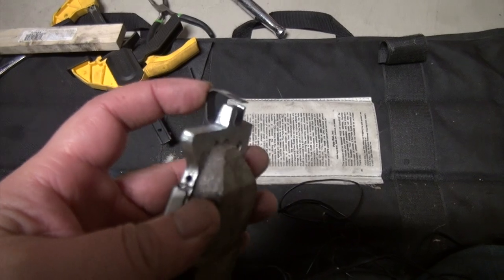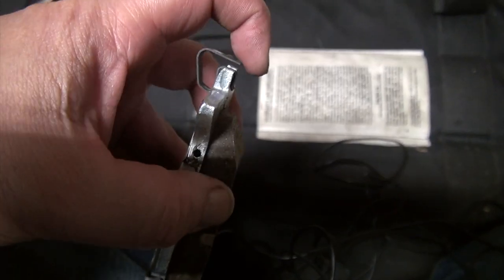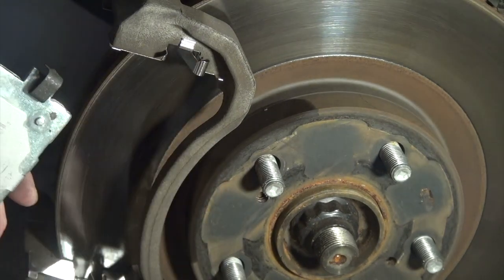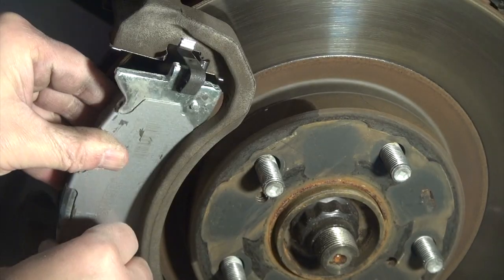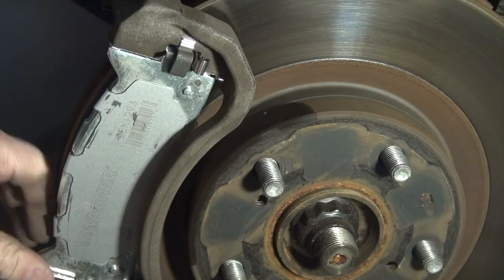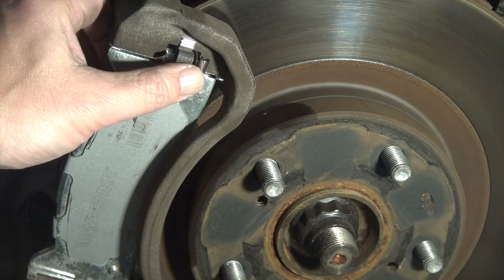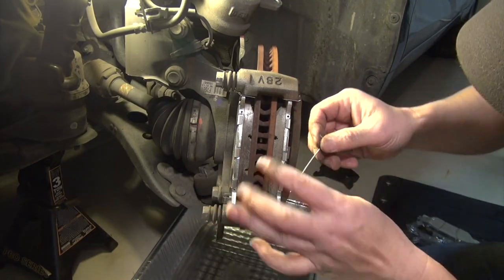On your new brake pad, do not forget to put on this little clip here. This serves as a warning sign — when your brake wears down to this level, the rotor will start to squeak and that's when you know it's time to change your brake. Once you have the clip on, there are two slots — top and bottom — and you basically slide it in and push it in. The indicator is in there and it also helps lock the pad in. You just need the top part, not the bottom, then shove it in and put in the spring.